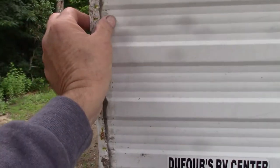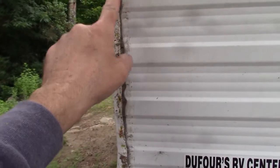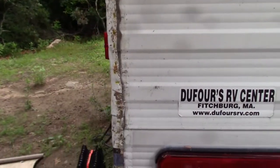You can see I got the squish out here. And then the trim is going to get butyl tape on the outside and on the inside, and the screws go in the middle. You can see I put a lot of staples in just to hold it into shape.